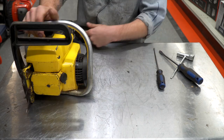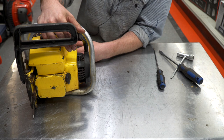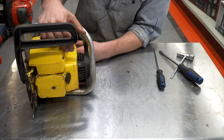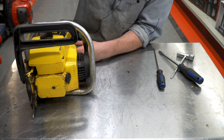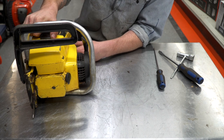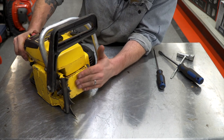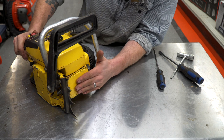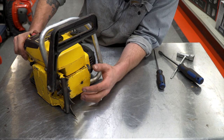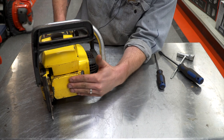Manual override oiler. These have an impulse oiler on them instead of a gear drive. A lot of the older saws started out with impulse oilers. It runs basically off a crankcase impulse, similar to the way the carburetor runs off of that. Instead of a worm gear-driven oil pump — this is the oil tank here, and then your oil pump is actually inside here with a plunger. Your oil fill cap is here, and this is actually your oil tank.